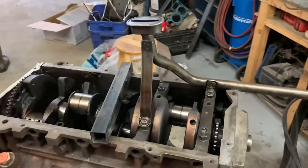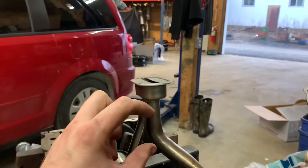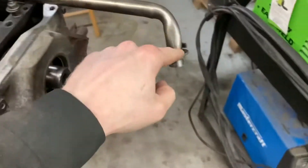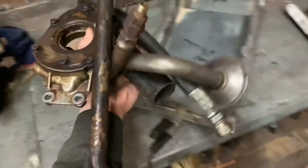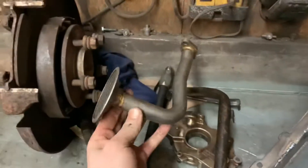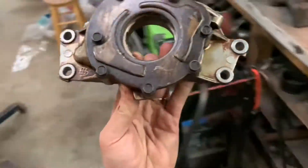I got this one bolted in - it's not exactly where it's going to be, but it's really good for sizing up how high I'm going to be. I got to cut this one inch lower, which is not a big deal - I can take an inch out right here. But I have to go home because I don't have an oil pump here for a mockup. I was going to have it all cut, ready, done, and then I realized I had nothing to stick this thing into to be sure it's going to be right. So I'll run up the road, grab the oil pump, bolt it on, and then we can make our pickup tube. I got some more parts: oil pump, random hydraulic fittings, a pickup tube that doesn't belong to this but is really cool, another Chevy pickup tube, piece of pipe - this stuff's like gold now.